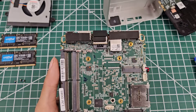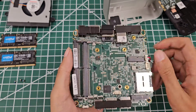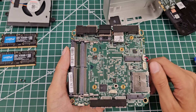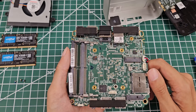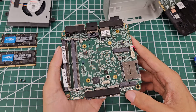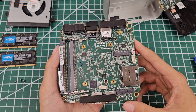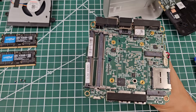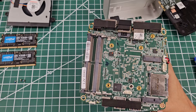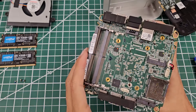I plan on using those internal 5-volt pins for an internal fan header. I would have really liked to see an additional M.2 storage slot here — this could have fit a 2242 storage drive, which would have been fantastic for such a compact machine since you only get one SSD slot. There's also a COM port header and some speaker pads — if you wanted to build internal speakers, one would be speaker right and ground, and the other speaker left and ground.